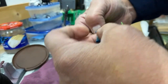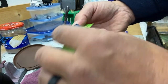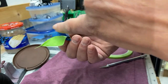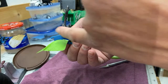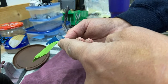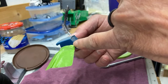Now, one thing I am going to teach, I'm not going to do it myself, so call me a hypocrite tonight, and I'll explain why I'm a total hypocrite on this one point I'm about to explain. Now, what I like to do, if I got a complicated tape job, and this is not a complicated tape job, this is an easy win. If you were looking for a good place to start, do this. But if I were painting down the side of a sleeper where I had lots of rivets and door frames and stuff like that to seal around. After I was done taping, I would come back with the color, my base color, which is Sovereign Blue, and I would paint over this tape and seal the tape. Okay? In those circumstances, I definitely would seal it with the base color.